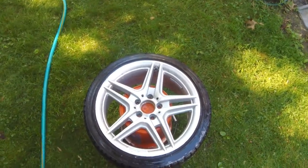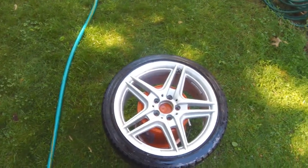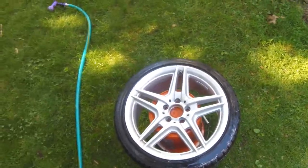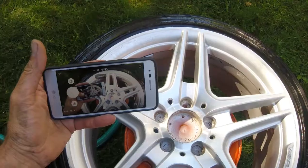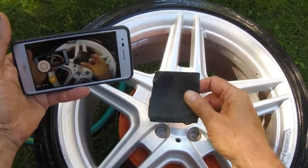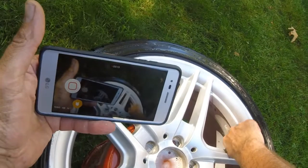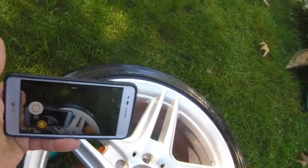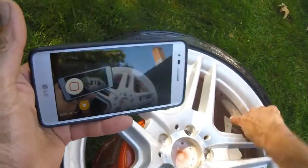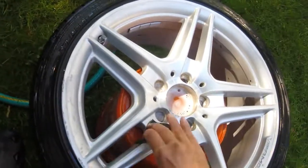Already cleaned the backside. Going to take this 3M pad - the green one first - hit the whole thing, get the rest of the dirt and grease off. Then I'm going to hit it with some 220 wet/dry sandpaper. You got to sand everything. If you don't sand it, the paint ain't going to stay there long. I'm not painting from here down - this has got a nice powder coated finish on it that'll take the rocks and crap. Just basically painting from here over to here.